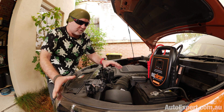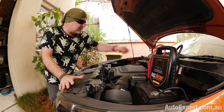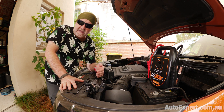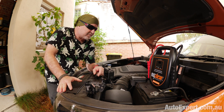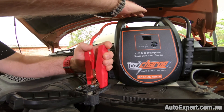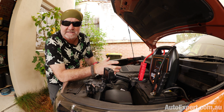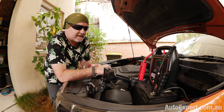It doesn't need to be charged up. What you can do is use the residual energy that's still in the notionally flat battery because, I just checked, the battery here is okay - it'll adjust the electric seats, work the headlights, and drag the Bendix mechanism across to try and engage the starter. It just doesn't have enough grunt to do the cranking and get the engine up and running. So you just expose the positive terminal - red goes with red. Even a politician could get this right. Black goes with black, and you get some green lights up there that say okay, I'm doing my thing, and then there's a countdown.